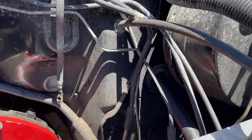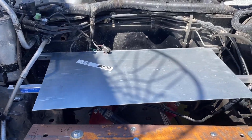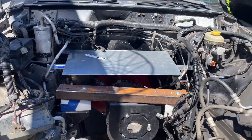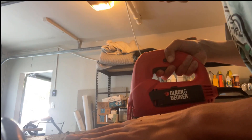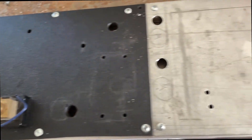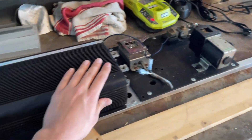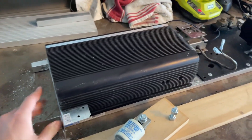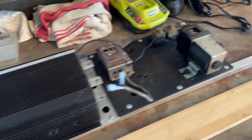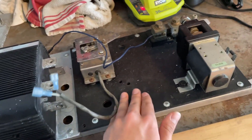Now it was time to mount all the other electric components in the engine bay. I started by creating a platform over the electric motor for the components. We got the second bar in. This board would house the motor controller, shunt, main contactor, and potentiometer, as well as some ancillary cables. Progress was slow and steady. I got some of the electric components mounted to this little platform that's going to be going into the engine bay of the Jeep — we have the motor controller, potentiometer, shunt, and contactor, along with holes for all the cabling to come up into this platform.